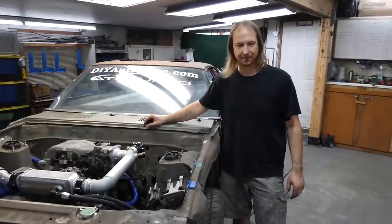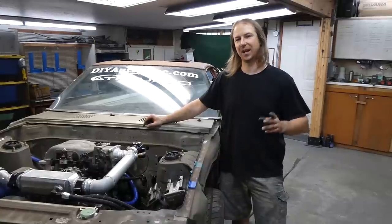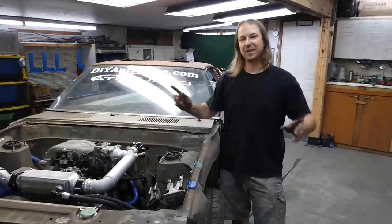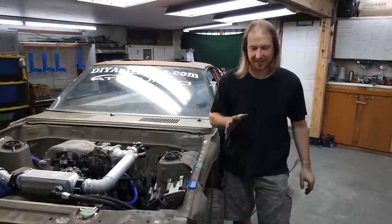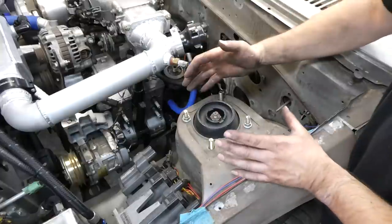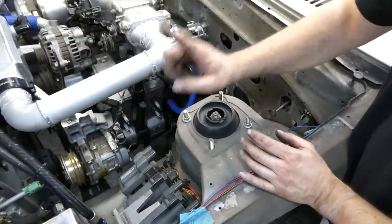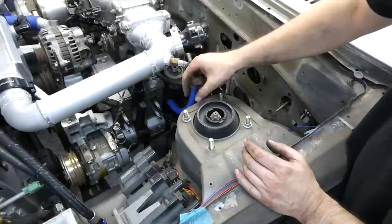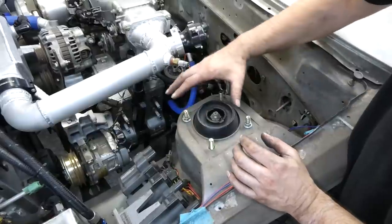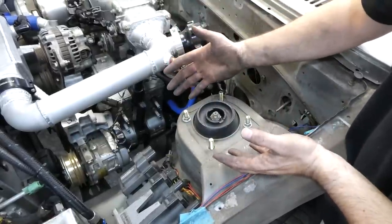Now if you recall back to episodes 39 and 40, I was able to use RX-7 front control arms by using 82 to 86 Mazda 626 ball joints. And I figured that I could correct for that excessive positive camber by moving the top of the shock tower. Now, that ain't gonna happen for two reasons. One, I would have to move it in about an inch. And B, even if it was in the right spot, moving it would offer no adjustability.